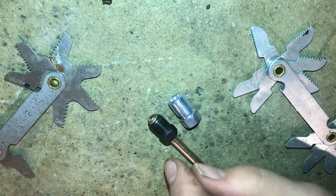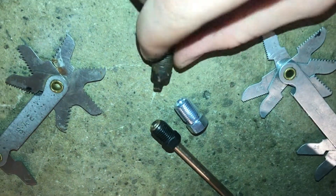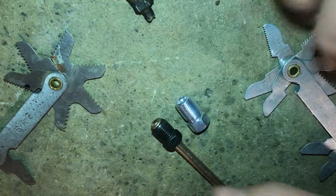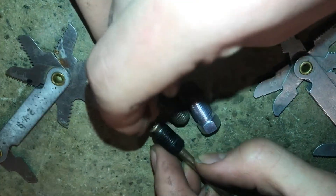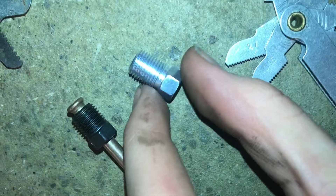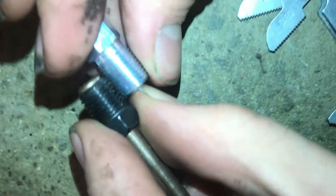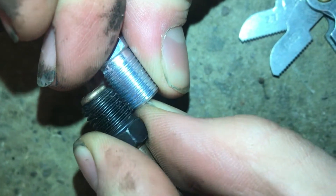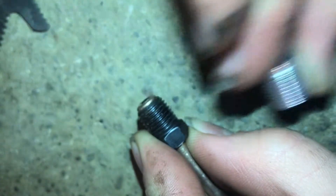If you get your brake line — normally they have fittings on here — and you compare it to your old fitting and find one that fits, it looks like it'll fit. It looks like the right size. It looks like the threads will mesh. This fitting here is the correct size and has cleaner threads, so we can see it looks like it'll fit and thread in. It's very close, but if you look closer at the threads, it's hard to see they aren't meshing perfectly.